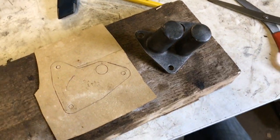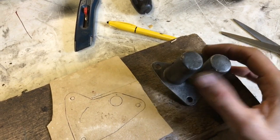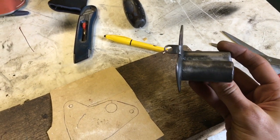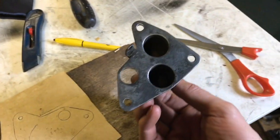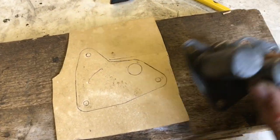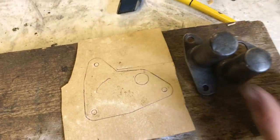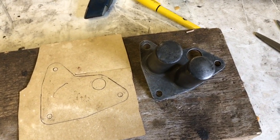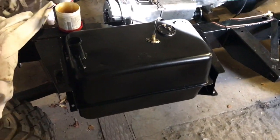I've taken out the dents on the dust cover for the selector forks on the transfer case as best I can. The forks are much thinner than the holes, so it fits perfectly well. Before I paint it, I thought I'd make up a template for it — like a gasket — because it doesn't really come with one, but it might as well stop damp getting in there.